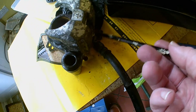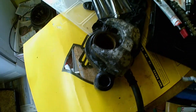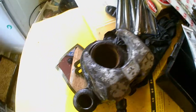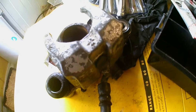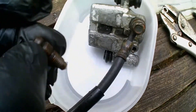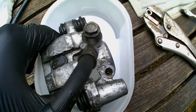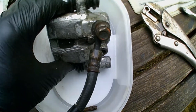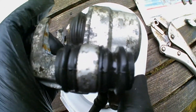I'm going to remove the banjo bolt, which probably needs another washer anyway, and I may as well get a bleed nipple while I'm at it. It's going to be about 40 quid I reckon. I know it's going to be hard as hell to undo so I'm thinking heat, but I've got to watch it — there's a lot of rubber around. I've just got the brake bleed nipple out and it was airtight — it hissed as I opened it. You can actually see a little bubble of brake fluid in there so it was liquid type, but it still looks a bit rough.